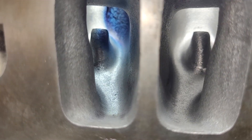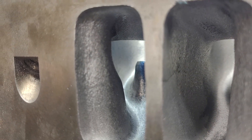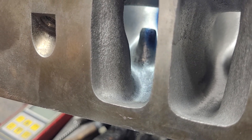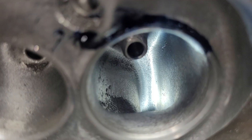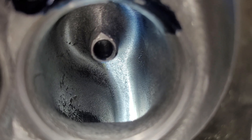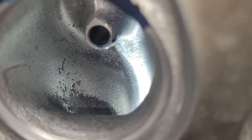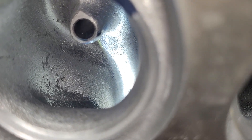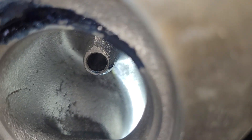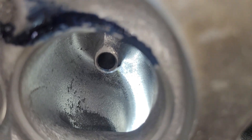Notice how narrow that roof is — narrow roof, really wide floor — very difficult to get the burr in. That corner on the roof the burr didn't even touch; that's going to need more work. The roof is really narrow until it hits the guide and then it fans out — it's an interesting design. We've got some inclusions in here, but an inclusion is not that big a deal; you don't always want to take them all the way out, especially if that screws up your area. I wasn't able to get all the way down there with the burr. You still see a little bit of a paste ooze line, but I don't want to go too thin on that casting near the valve seat.